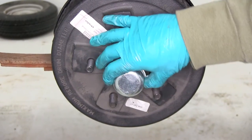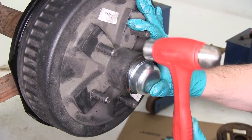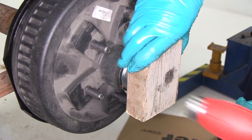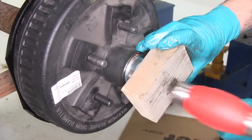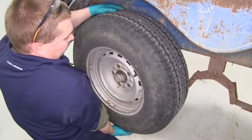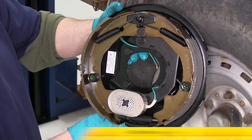Then here's the dust cap that we'll need to put on. Go ahead and set our dust cap into position. Once we get our dust cap lined up, we'll use a small block of wood and go ahead and tap it into position. Now we'll go ahead and repeat the same process over on the other side, but this time we'll be using the brake assembly part number TR-BK10E02, which is for the right-hand side of the trailer.